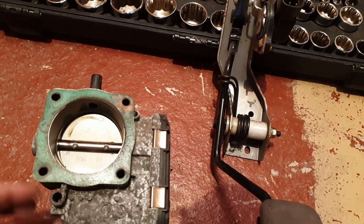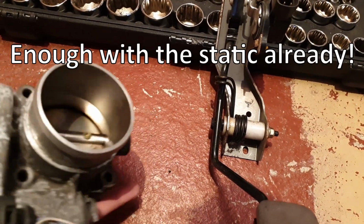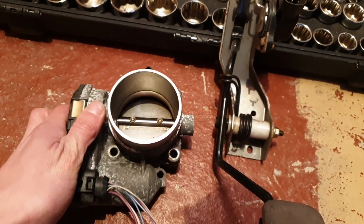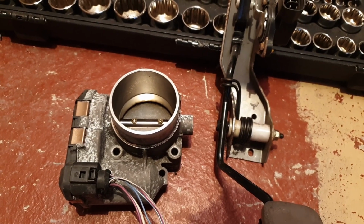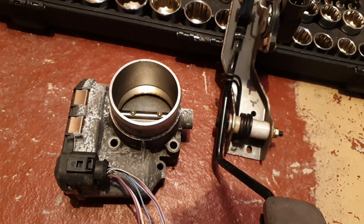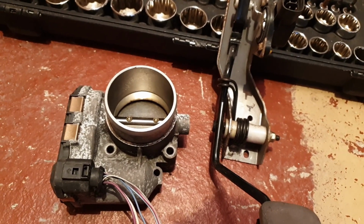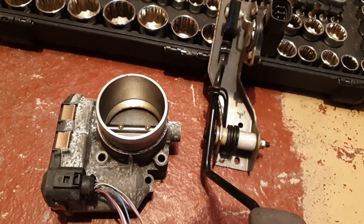Another reason is engine safety features. So I can tell the ECU that if I see certain parameters like coolant temperature, oil pressure, to only allow me to open the throttle so far. Some of you with OEM cars will have heard of the dreaded limp home mode, but actually that's quite a good thing, especially on track. And with a standalone ECU, I can always override that if I know it's just a sensor issue.